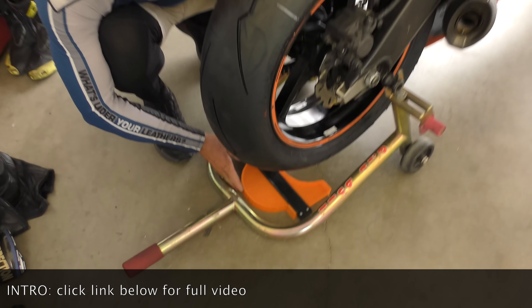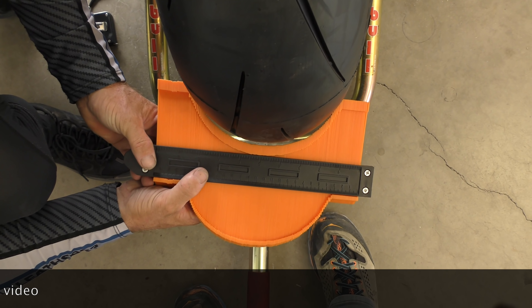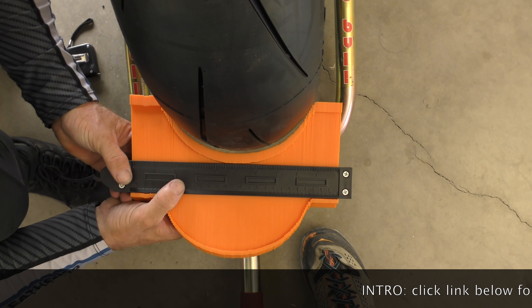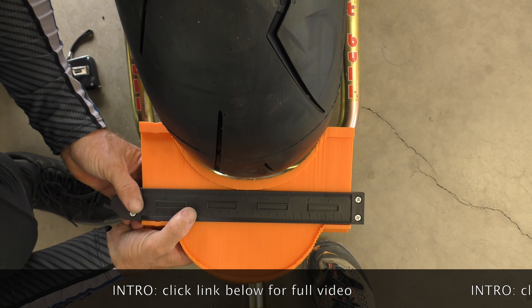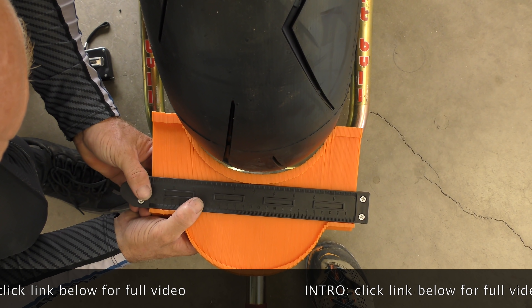At this point we've got to go ahead and take the wheels off, get the tires changed, and then check what happened to the pitch of our chassis. The Dunlop we know is super soft, and the Pirelli is even softer. So that's going to need higher pressure to compensate, and then we'll do the same profile test.